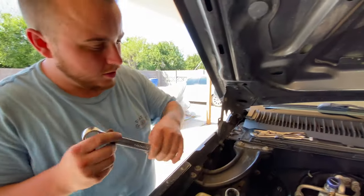With this new condenser we'll probably have new ones of these included. The proper way on these trucks to get the condenser out is you want to pull the radiator - not pull it out completely, but take it off its supports here. Being that we have a fan clutch in the way, I'm trying to avoid having to take all that off just to pull this out.